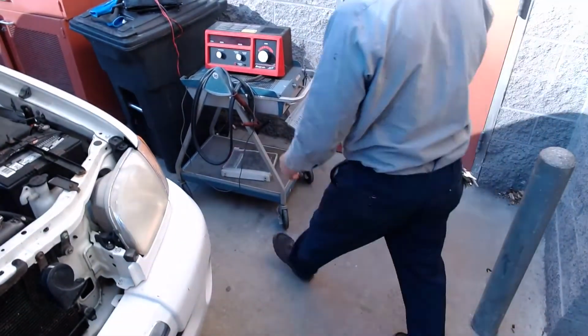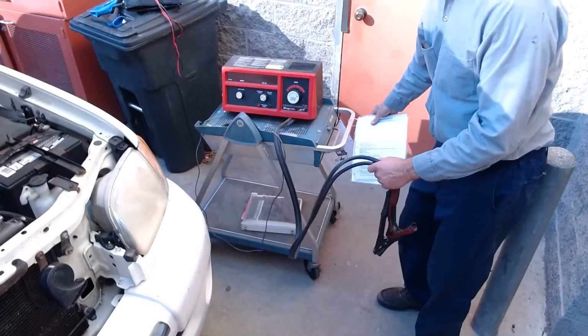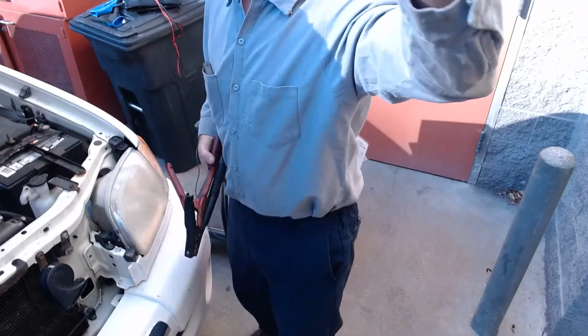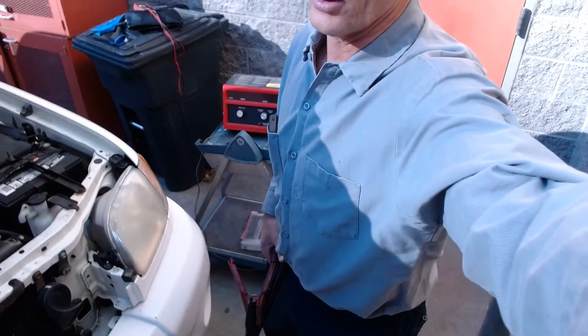And I'm going to take these heavy internal 18-volt leads, and I just want to remind you all the instructions you hear for doing an alternator output test. Checking voltage with the voltmeter is like checking your pulse. It's an okay test, but it's not really conclusive necessarily. The alternator output test is going to say, okay, how much amperage and voltage, etc., is that alternator going to give us?